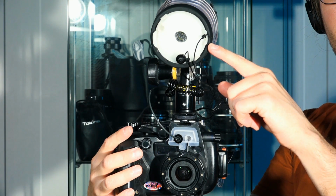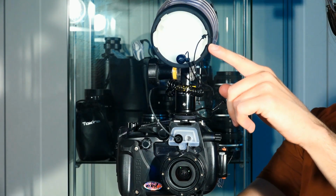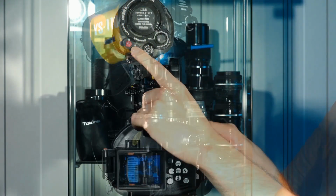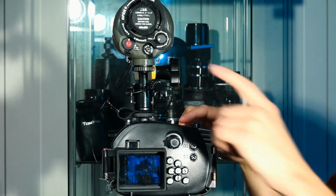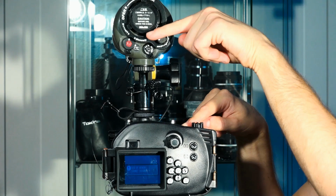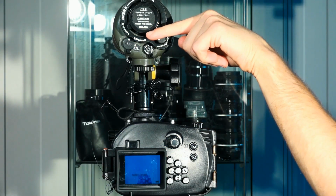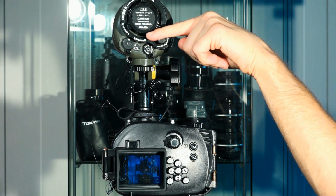Note now the time also it takes for the modeling light to come back on, which means that the flash is ready to be used again. Also confirmed with a red LED light on the back side. Also can be noted here that there were half-empty batteries in the flash unit, which explains the prolonged recycle time. But with fresh batteries, the recycle time is cut much shorter.